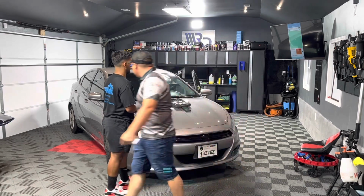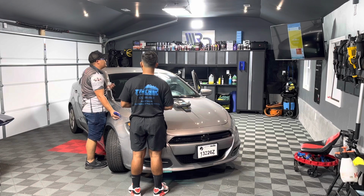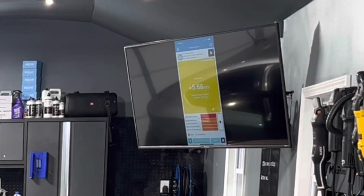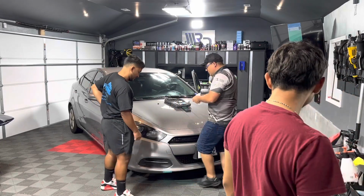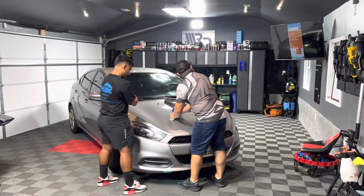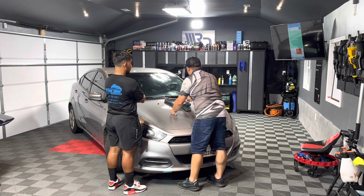When you see 8 mils, that's basically a lot to play with. Sometimes whenever a car is being repainted, you got even 14 mils or something, depending on the painter. So you have more liability. Exactly. This one here you got 5 mils, and over there you got like 8. That area I know has been repainted. Over here, this is like 2 mils, close to 2 mils.